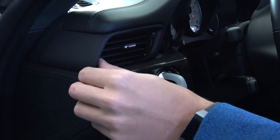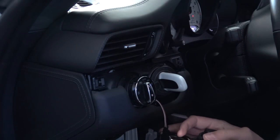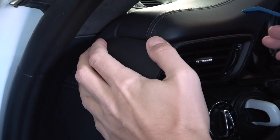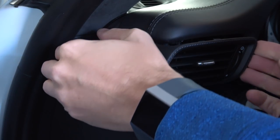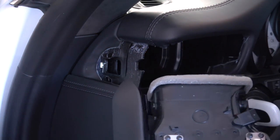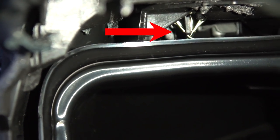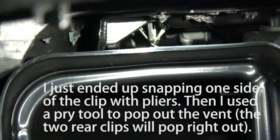This is all online in Musicar's video, but I'll just do it here for fun. It has a harness here - just leave that hanging, shouldn't cause a problem. And then we're going to pull this vent out. I've got an access clip back under this speaker grill. We're going to put a rag here to keep it protected. That little metal clip up there is what we've got to pinch, and we can push this speaker grill out. We just need some needle-nose pliers to get in there and crimp that up.